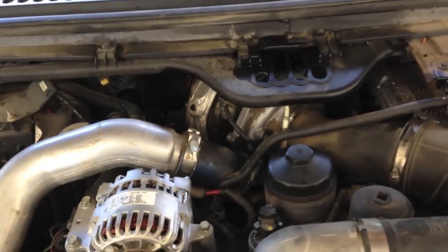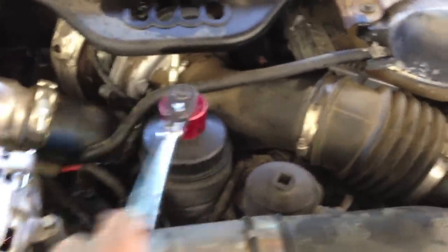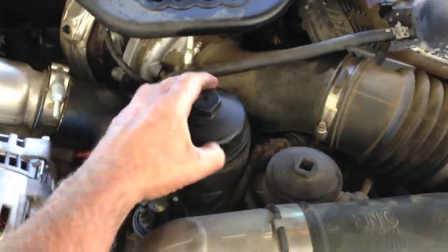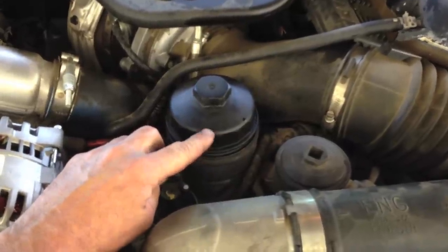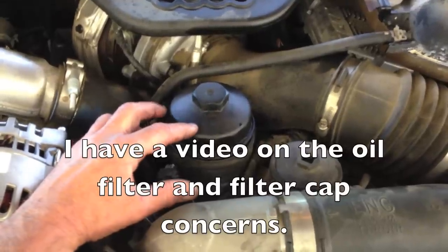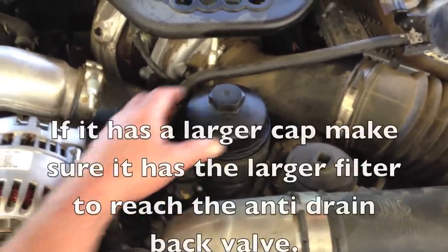From the outside here, the first thing we want to do is pull the oil filter off. When you get the filter off, hopefully everything is working good and there are a lot of oil drips from it, because that tells us the anti-drain back valve is in and it also has the right size oil filter. Sometimes when you get the taller caps on there, we start suspecting a bad oil filter. When you have the wrong oil filter or wrong cap in there, that leads me to believe unfiltered oil, and we want to start looking towards the IPR valve screen.